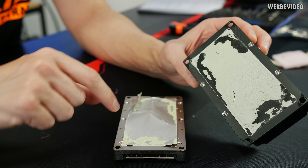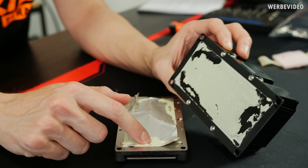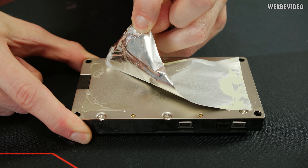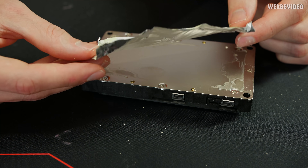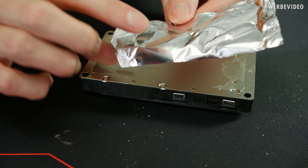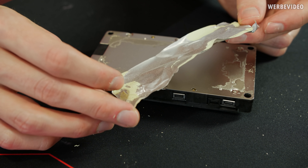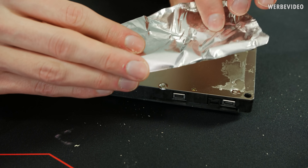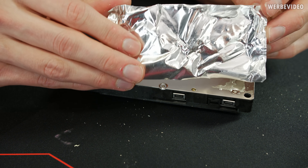There's definitely a thermal interface material here, and it's quite weird — I've never seen something like this before. It's like an aluminium foil with a sticky thermal paste. Same on the heatsink — just an aluminium heatsink. That's probably one of the weirdest thermal interface materials I've ever seen. I'm not sure why we have a metal foil with direct contact to the CPU surface but no thermal paste in between, and then something that looks like thermal paste on top making contact to the heatsink. It feels a little like indium foil but also a bit too hard for it — could be aluminium.